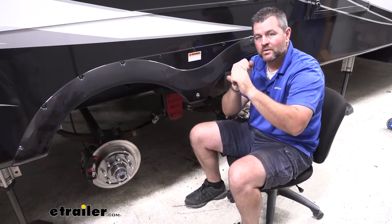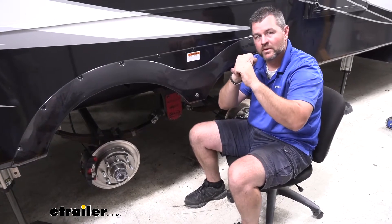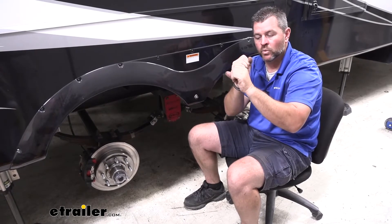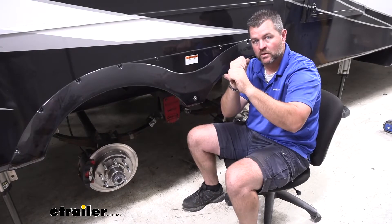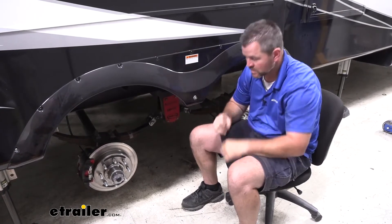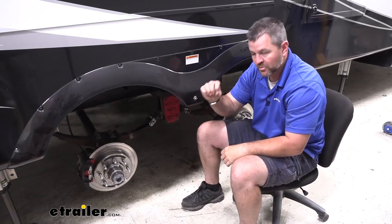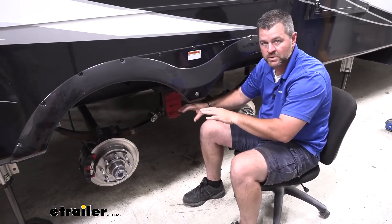That plastic is not strong enough to hold up to the metal. As it breaks apart, once it all breaks apart in there, it starts to wear out. Now that shackle bolt inside of there — that spring end starts to move and it loosens up. When it starts to loosen, you have play in there, and that play could affect the rest of your suspension components.